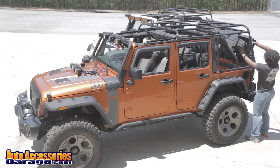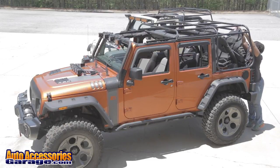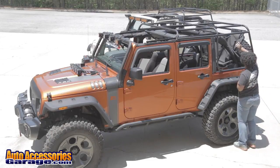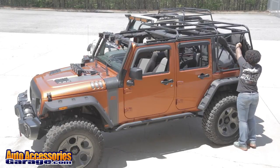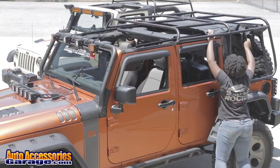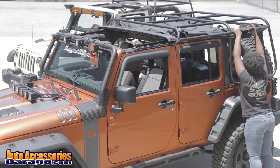With help from a second person, position the header and soft top fabric in rear of vehicle to prep for installation. Loosely attach the rear Velcro flaps to the lower rear bar of the cage. With help from a second person, slide the header slider carriage assembly into the rail. Carefully slide the entire assembly forward to the sound bar. Slide the fabric carefully to avoid snagging.